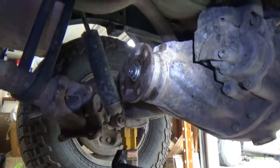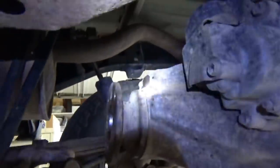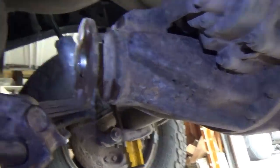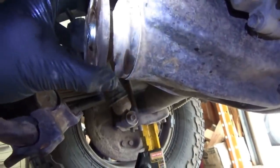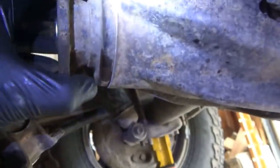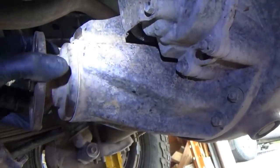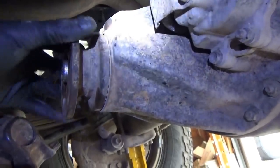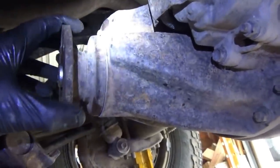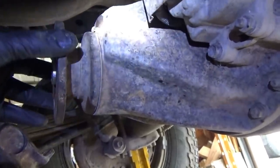The last thing on this 2004 Toyota Tacoma that needs attention is the rear differential. I was greasing the drive shaft and noticed there's some play in this pinion — in and out and up and down. The pinion bearings have some significant slop, and up at 260,000 miles with hard use — pulling logs, pulling stumps — I think they just developed some free play.